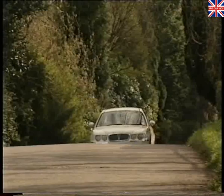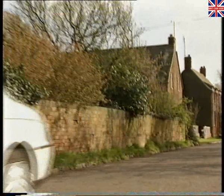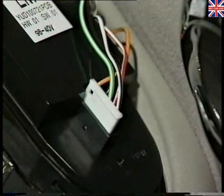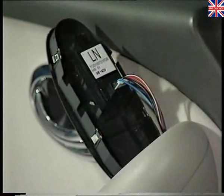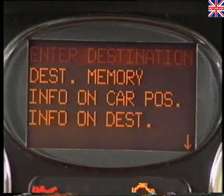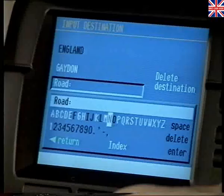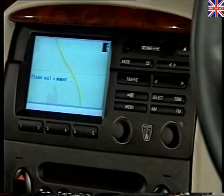In addition to the diagnostic line, there are two further bus systems to consider: the separate window lift and satellite navigation buses. The window bus, or wind bus for short, is a discrete connection using a single wire between the driver's door module and the GM6 controller, which controls all the window lift operations. The GM6 receives signals directly from the switches on the remaining doors. The satellite navigation system is covered in a separate video. However, note that the low-line system has a separate bus system to send graphics information to the display in the instrument pack. All other inputs to the navigation computer on both the high-line and low-line navigation systems are made via the K bus or are hard-wired.